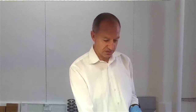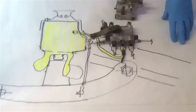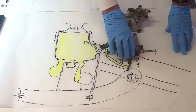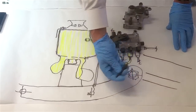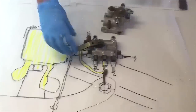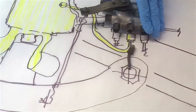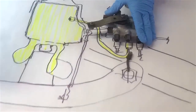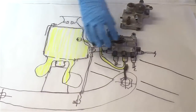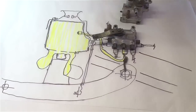I did a little sketch here. You can see the axle of the suspension, the airbag at the back, and the leveling valve on this part. There are air fittings that go right into this valve. We have the lever here that is connected to this part of the suspension, so any movement of the car will move this lever. This lever will basically decide if air is going in, going out, or if air stays.